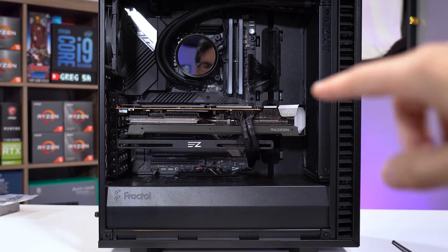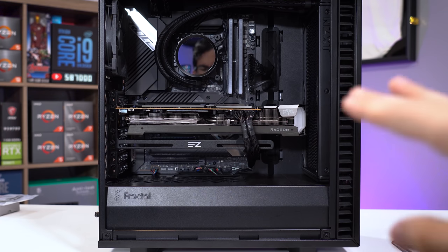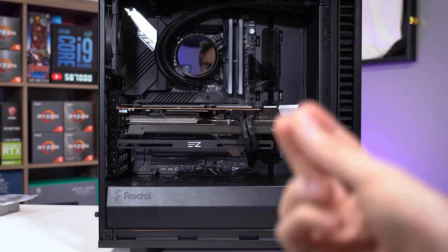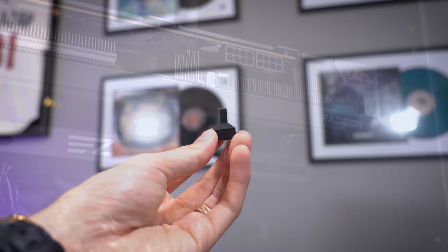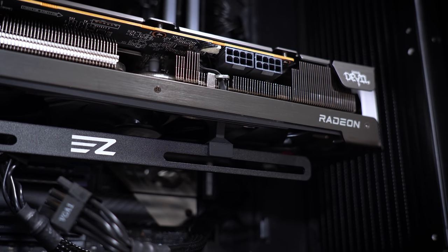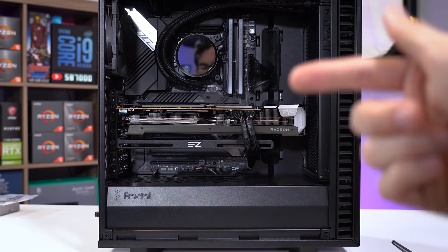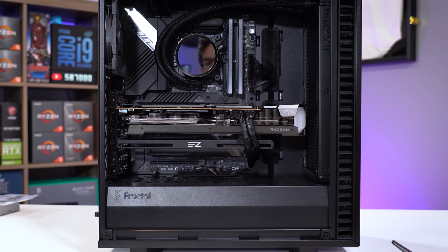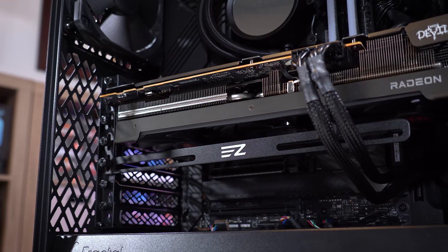There we go — I think that looks pretty good. The sag is still probably there just a tad. I could fix that with a few adjustments. All I really did was loosen the thumb screws on the left side, prop the card up, and I switched to the longer rubber standoff because the bracket itself was interfering with the fans — it sits a bit recessed under the card. So when your card is thicker, the bracket could hit those fans if raised high enough, and I got around that by using the included longer rubber standoff.